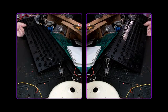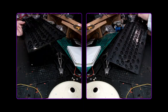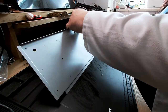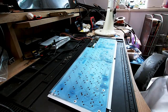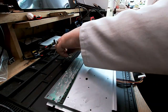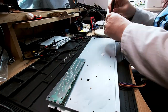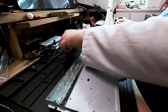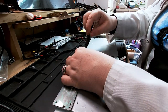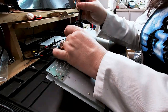Turning back to our keyboard, it's time to get those plungers back in and the keyboard reassembled. I'm not going to lie to you, this is a slow, laborious process. This is sped up about a thousand times and still it took me a good 20 minutes — and that did not include the time I had spent looking for an errant plunger. The tray is painted, we can put our brand new matrix in there — look at that membrane, that's beautiful — and then attach it all with the long and short screws. There are a lot of little tiny screws needed to put this keyboard back together, including three long ones that go in the PCB that I didn't notice until I finished, which meant I had to take all the screws back out, find the longer ones that go through the PCB into the board, and then put it all back together. There are just days that will drive you a little bit insane. This was one of them.